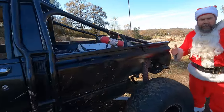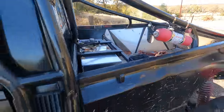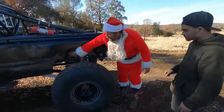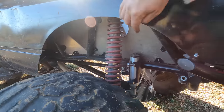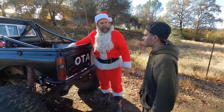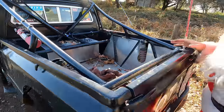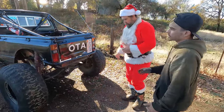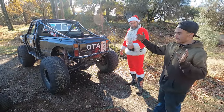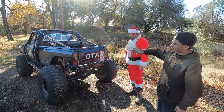There's also a fuel cell. In the back — so on this one he cut the whole back of the frame off. The back of the frame was fully dry rotted out, twisted like three or four inches, so we just cut it off. All tube work in the back — completely back-halfed. I love that you can see all the stainless steel panels in there — he made it a truck bed again. You throw stuff in the back — usually beer cans. Then he pinched the rear down. This was a short bed and when he did the stretch he stretched it 12 inches — was at 101-inch wheelbase, now at 113.